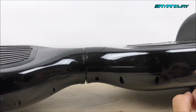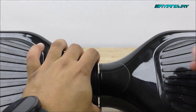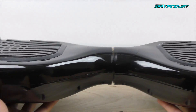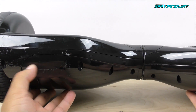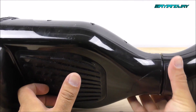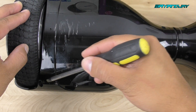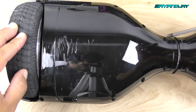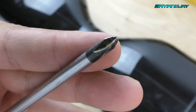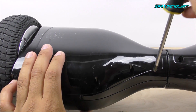The first thing you want to do is identify which side it is. If the light is off you don't need to worry about that side. Then go ahead and turn the hoverboard off — the power key is somewhere back here. Make sure the light is off as well; you don't want it on as you may damage the components. After that, flip your scooter around and look for all the screws — it's going to be about nine screws. We have one, two, three, four, five screws on this side and about four screws on the other side. The only tool you're going to need is a Phillips screwdriver.